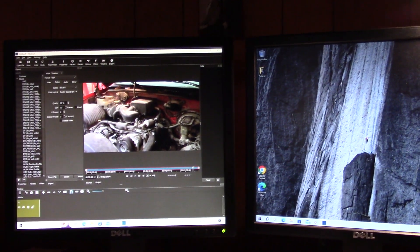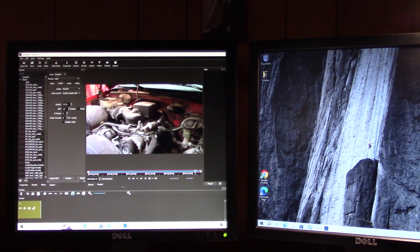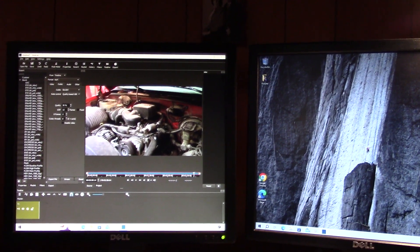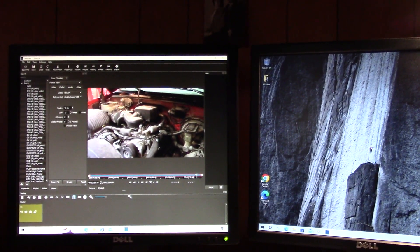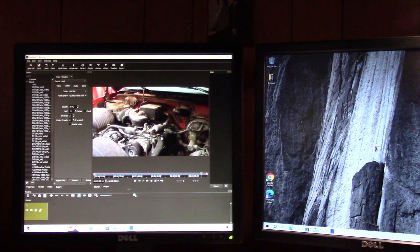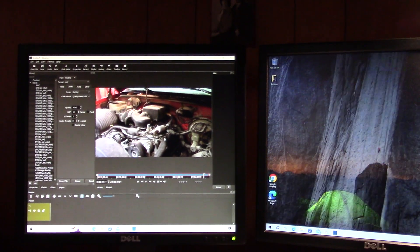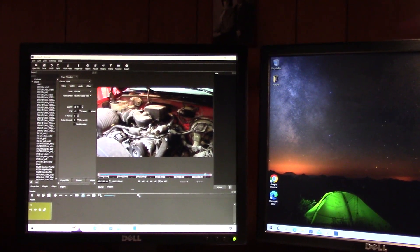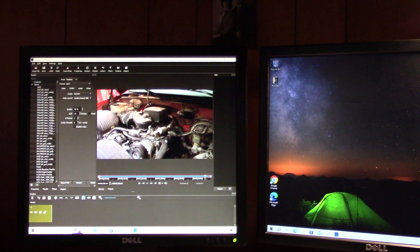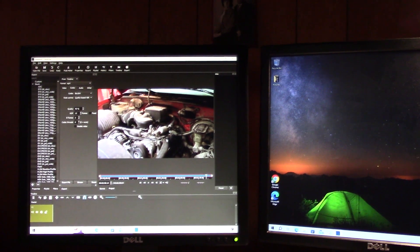Basically what's happened is the truck sat, just like you saw in the first video. It's leaking oil really bad. I also found a u-joint bad, a tremendous oil leak — I found out what that was later. It also ended up having a Pittman arm so bad the truck's almost undriveable. This particular video is a first start after what I consider a basic tune-up. I did not change the oil yet, did not change the fuel filter or air filter — nothing. All I did was plugs, wires, cap, and rotor because of how bad it ran.